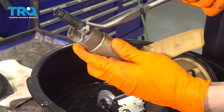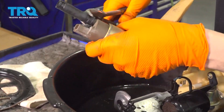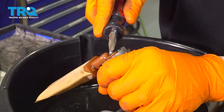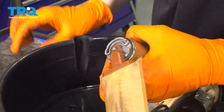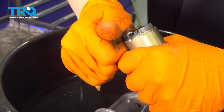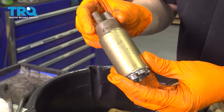Let's take the whole hose completely off — remove this one first and take it off for now. Take the hose off; it's kind of stuck on there, so give it a couple twists. Now pry this retainer out of here — it should pop right off. It's kind of stuck in; it's got a gasket. Here's your old fuel pump.